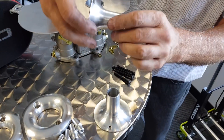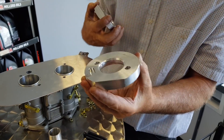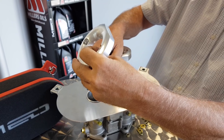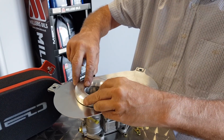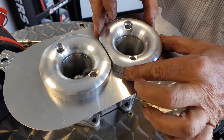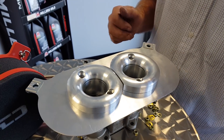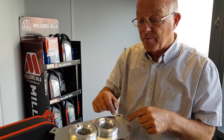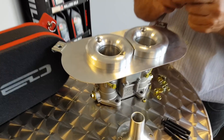These are the air horns and these are the stub stacks. You'll find one's got a cutout — the cutout is basically so that when it's bolted on, the air can still go in, around and down to the hole. There's also a little recess there that locates on that so it's absolutely dead right and snug. There's a flat on there as well, so both of them can run as close as possible to each other. You could actually run these just like that, or the stub stacks we have are slightly smaller diameter but will still do the same job.